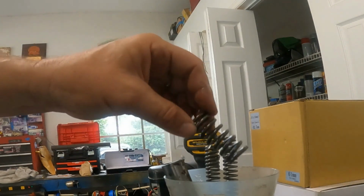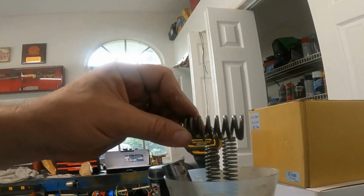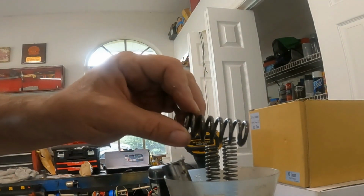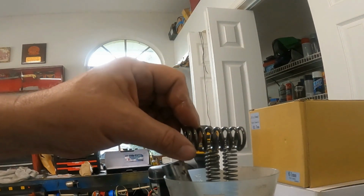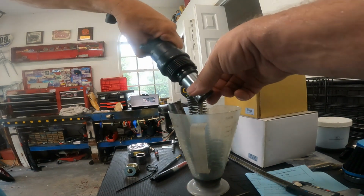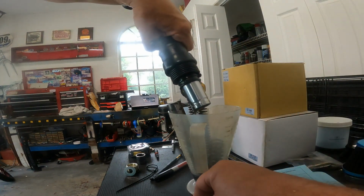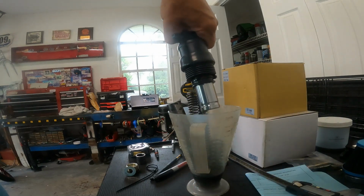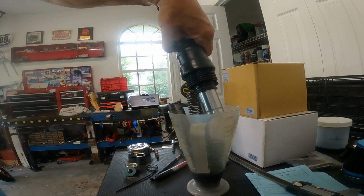If we can run a smaller tire, lower profile, grab a ½ inch there, and if we can do some tuning to the fork, we can actually run a longer spring and get more travel before we hit, and we can tune it for our weight. Or because of that little teeny spring that we have, we get metal to metal contact whenever we bottom out. And I think that's what's breaking these forks.